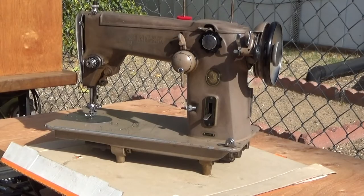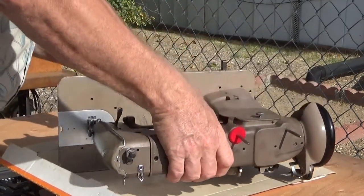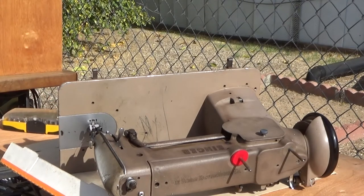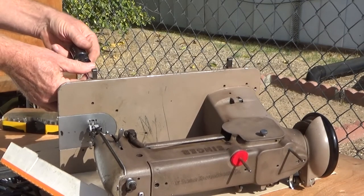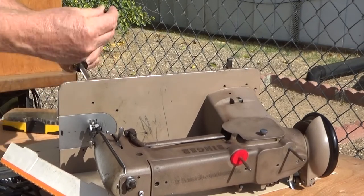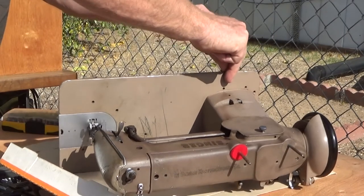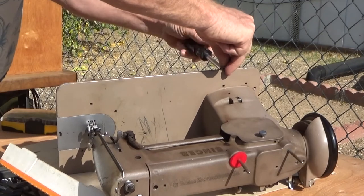A while back, I used this machine to demonstrate that a 9610 hook assembly would not only function, but would allow the use of 20U bobbin cases, which would in turn allow the use of standard 15x1 needles.